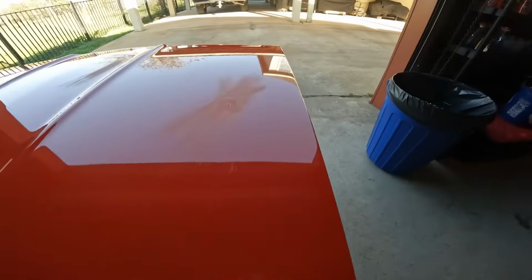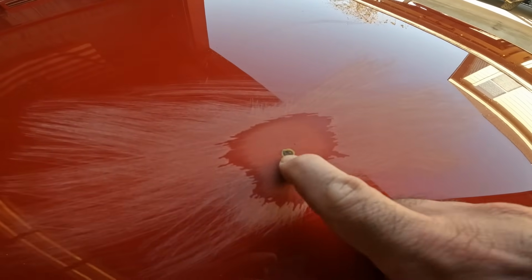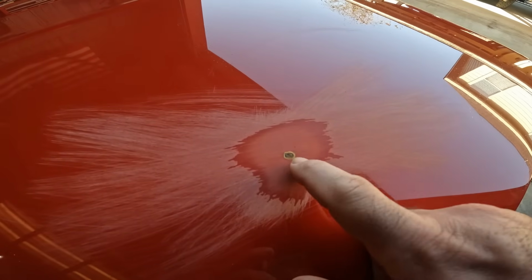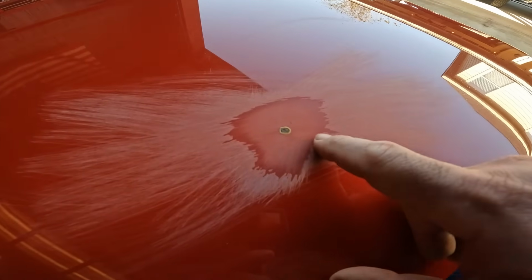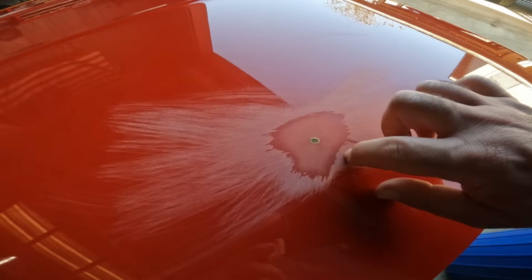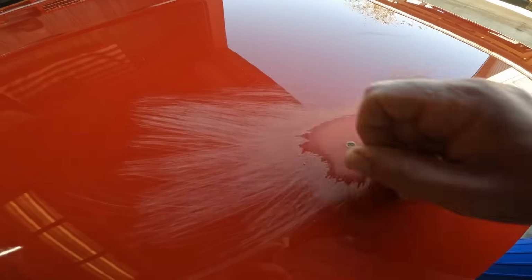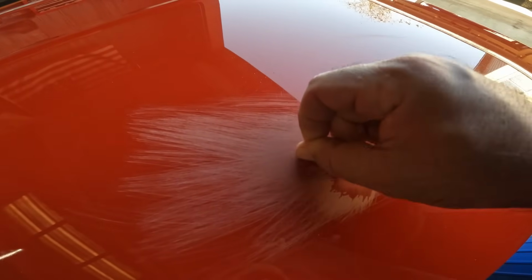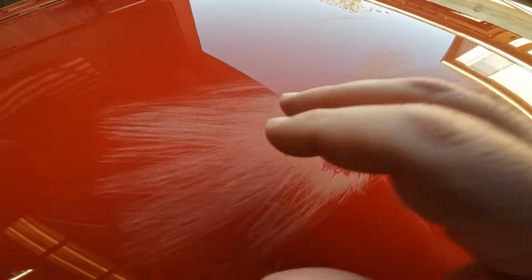And then over here on this side, we have another pit that you can feel. It's obviously rust, bare metal, some filler, red paint, I think, and a clear coat that is not adhering very well. You can tell how this is not feathering out. This is more like peeling. See that? Scratched off with my fingernail. And that's red. So that could be single stage.